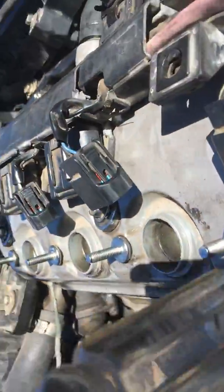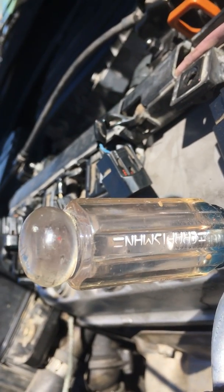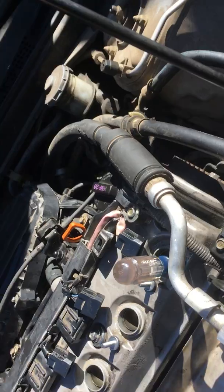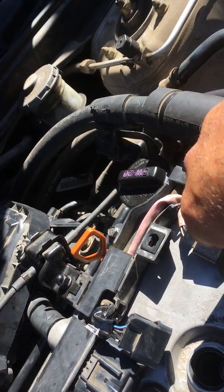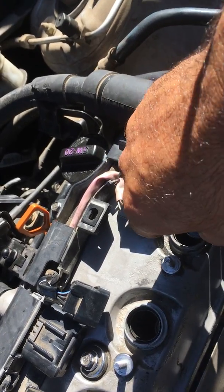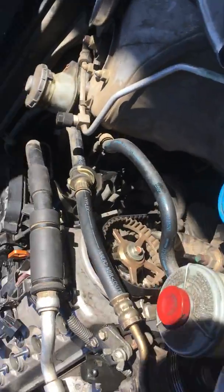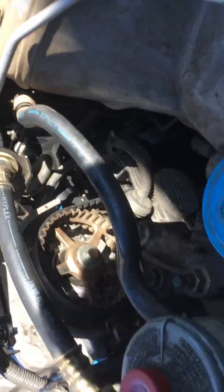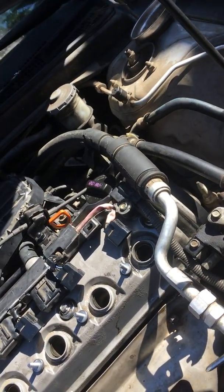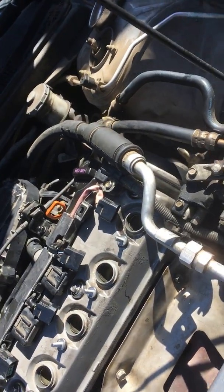I can feel it - see it coming up. As it starts to go down, you let it go down about a quarter of an inch, then you grab it, make sure you're on top of the piston, and you push down. That was me, that wasn't anything bad. Now I'm gonna do the next piston - number three. There was no clicking there, that was me. The screwdriver slipped in there, so there was nothing going on with that cylinder.